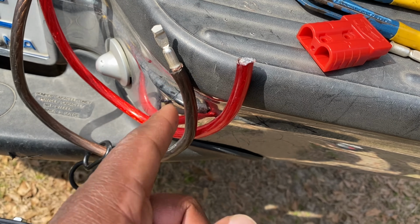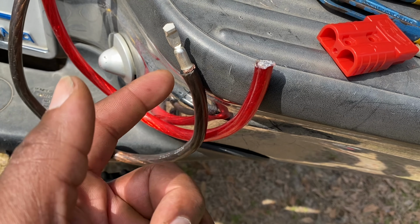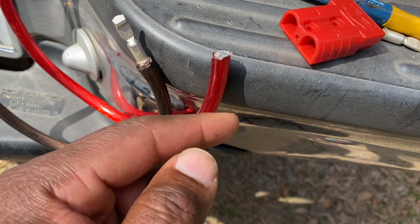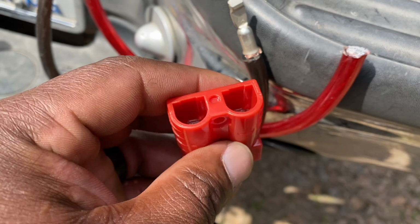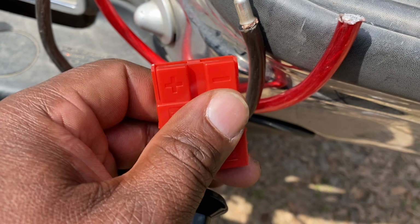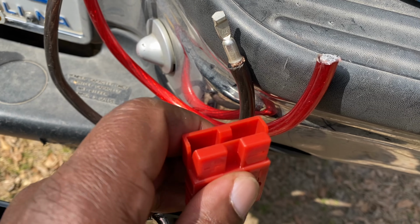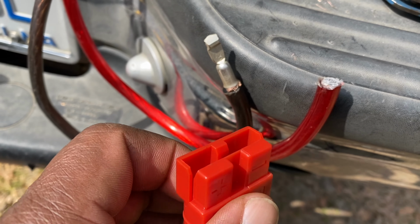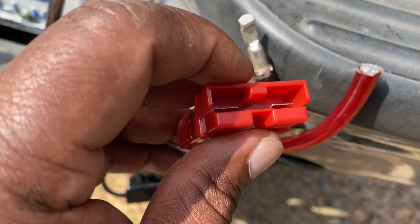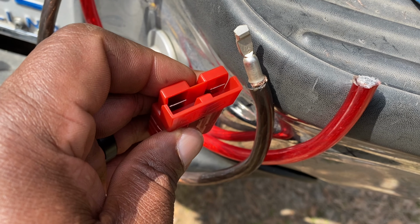Okay, quick connects. All you do is the same thing when you're putting on terminals. You're securing your wire back. You're gonna screw that down clockwise on the wire. So you gotta press that on with the vise. And when you're installing these, make sure you pay attention also to the positive and the negative, because when you hook these up to the other side of whatever connection you're making, you want to make sure the wires line up and are consistent. But that lip there, when we get done pressing it on, we're gonna stick it in here, and that's gonna actually hook on to that tab that's in there and lock it in place.